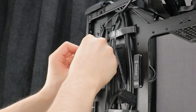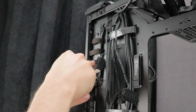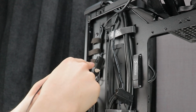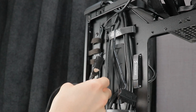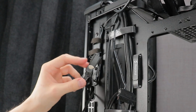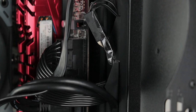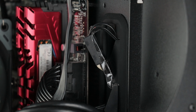The cable wraparound panel is fine, but if you want to add, say, a super compact ARGB controller like the one supplied with Cellentium PC coolers, they have very thin cables and are a perfect opportunity to wrap up that excess cable. The little controller box is actually bulky enough to come into the line of fire of the side panel when being replaced, so it needs to flap around a bit to avoid that. And during testing, I needed to access the rear compartment of the motherboard. So often, I just pushed it through the grommet into the main compartment. There's just not enough room in the back.